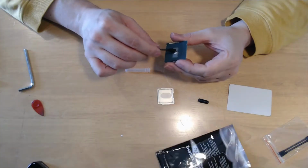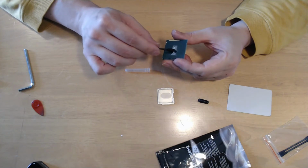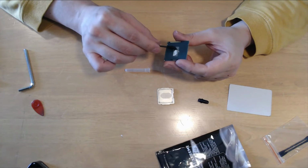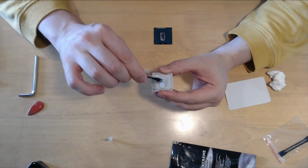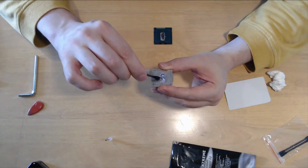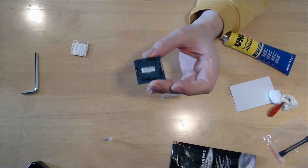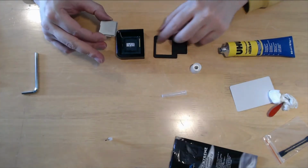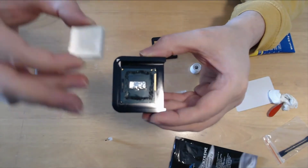Now it's time to apply the liquid metal upon the chipset using an earbud, applying a very small amount onto the die and then spreading the material equally upon the surface of the die. Do the same to the IHS, using the stain from the old thermal paste as a marker. Apply and spread thinly around the PCB and the IHS a small amount of silicone sealant, again following the traces of the old adhesive as a mark.